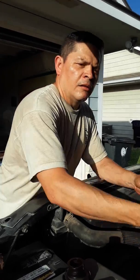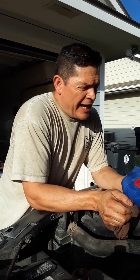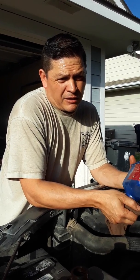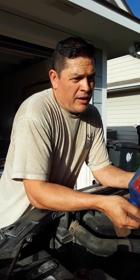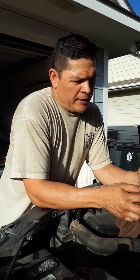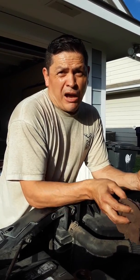How often should we check our engine oil level? If you've got an old truck like mine, this one's old, with 215,000 miles, and I got new gaskets put on it so it's holding the oil pretty well, I recommend checking it maybe once a month. Make sure you've got plenty of oil. Now they have computers that tell you, but I still check it to be safe, especially before a trip, like going home to visit after college. Check it before every trip as well. You're supposed to change your oil every 3 months or every 3,000 miles.